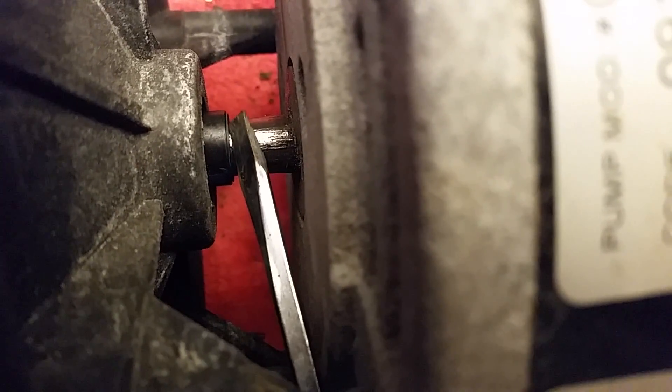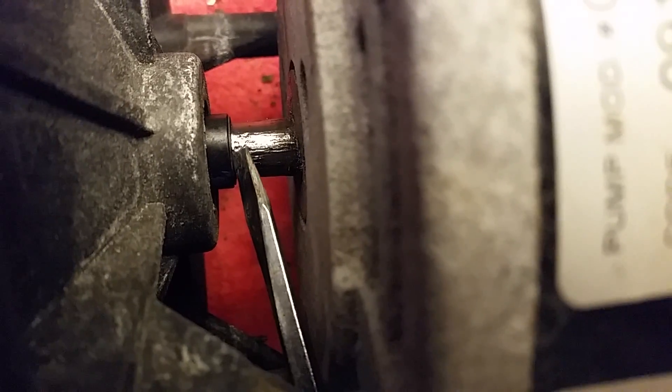Put the rings back on, the housing back together, and we'll be done. What you're looking at here is the bottom end of the impeller shaft — this is the metal that gets all rusted and pitted. The only thing I'm going to do is try to prevent this from happening again, where the rust fills this sleeve up inside and the metal expands and breaks it. I'm going to put Permatex right around this, all the way around, to hopefully get a little more life out of it.